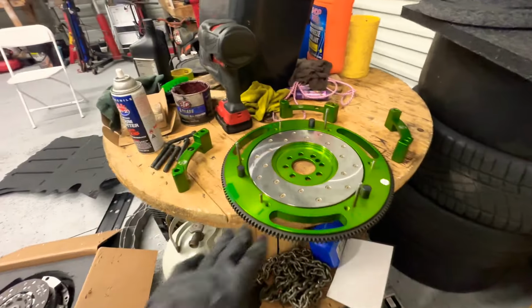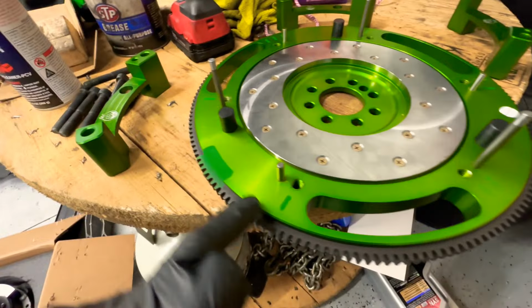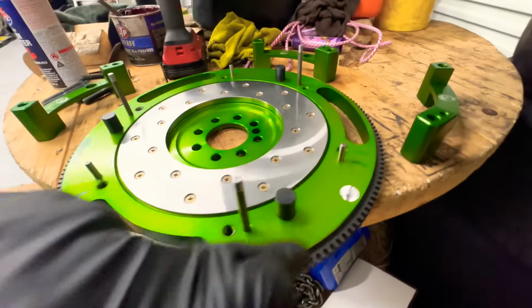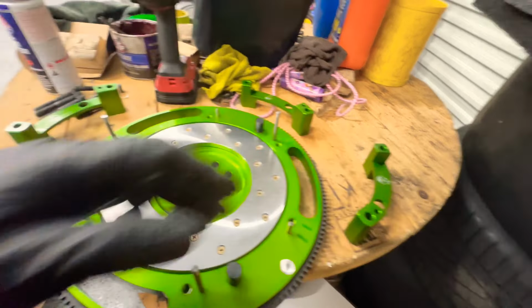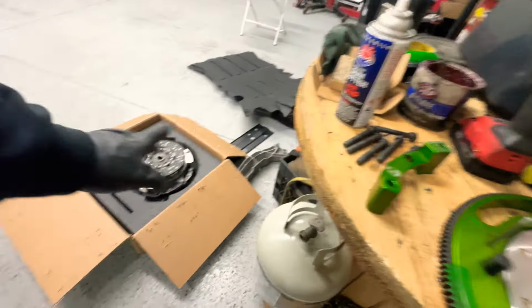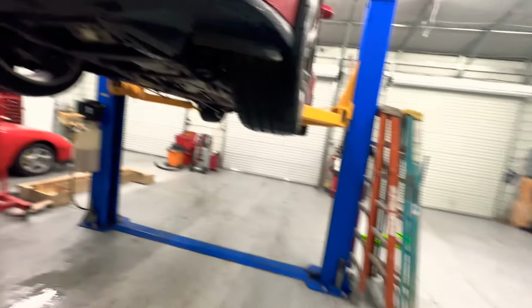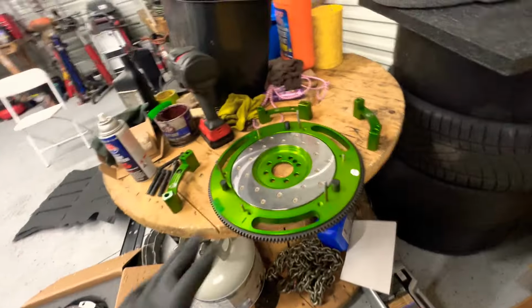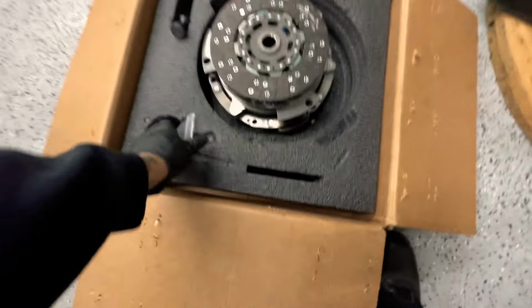All right guys, so I disassembled the entire thing. I kept it how it is. These things are marked twos and threes, so all these have the same marks, so don't lose them in that order. That comes out and then we're going to start putting it all together in the car. So let's start by putting together the flywheel on the car, torque it down with the bolt supplied